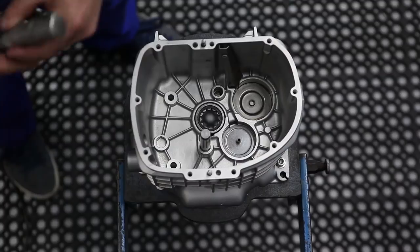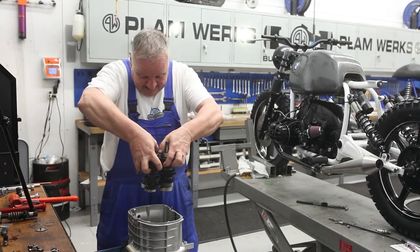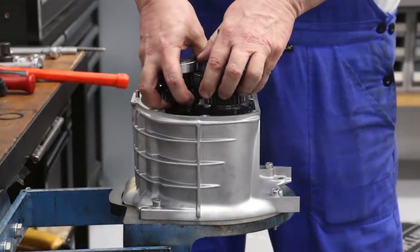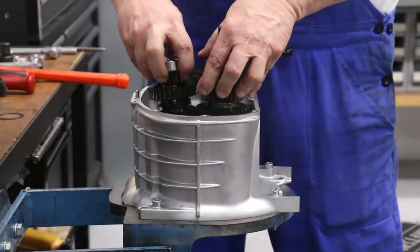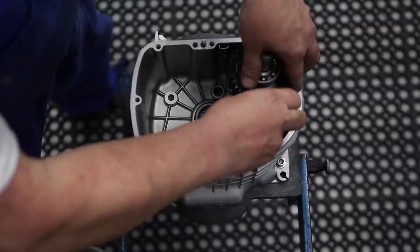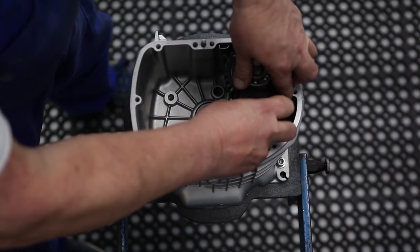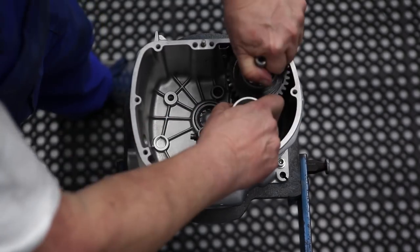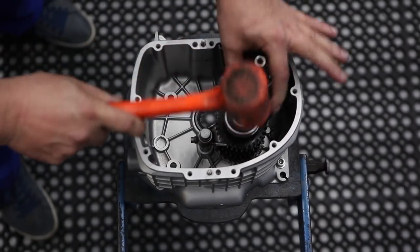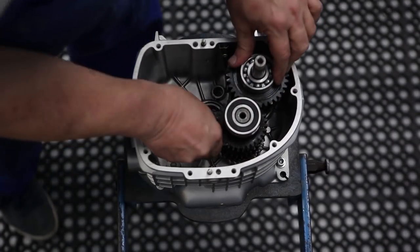It's a pretty important first step because you can't get it in later. So now I've got the two shafts just like they came out and the shift fork on there just like that. And I'm gonna line up the shift fork over that shaft. And then, with a little luck, just drop these right into place. Just give it a little tap. There we go, they just fell right in. Just need that little tap. Plenty hot. Those are home, everything's good.